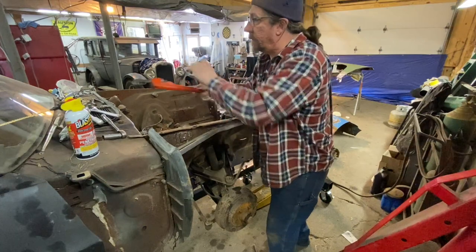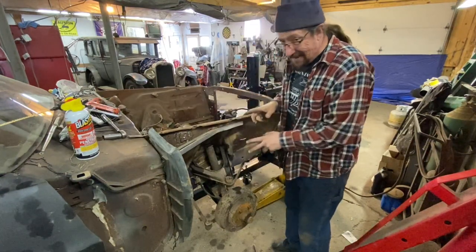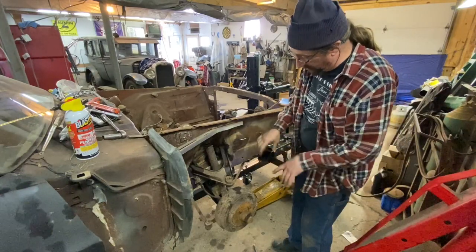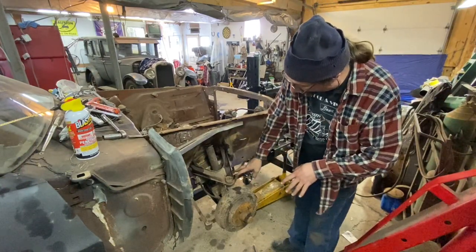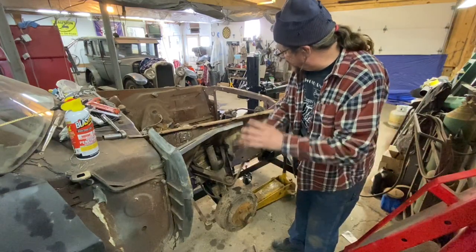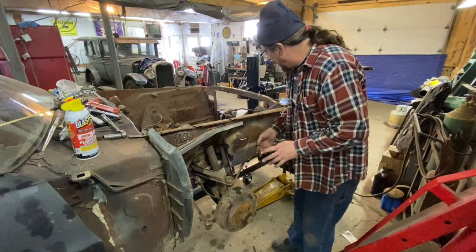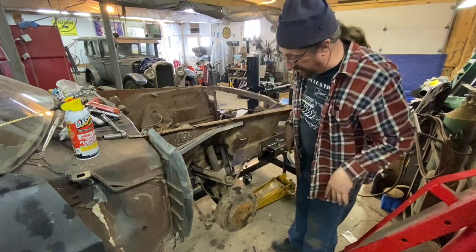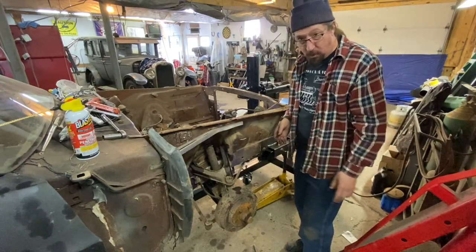Voila. Okay, now we'll go down and rat-a-tat-tat our torsion bar down and get this torsion bar out of this side. Then all we'll have to do is, I think I'm going to go ahead and pop the ball joints, and we'll just pop the steering shaft out, and once we do that, four bolts, we can drop the entire front suspension out of the car.